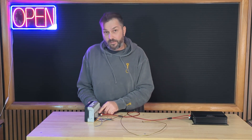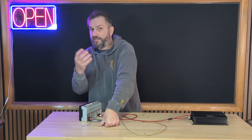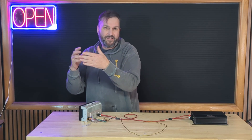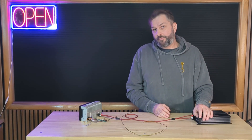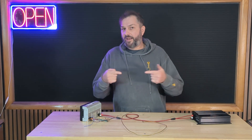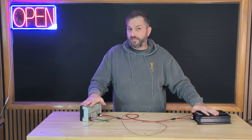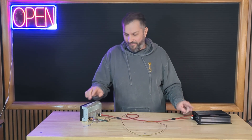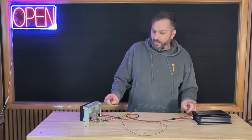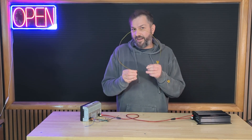The reason for that is because you have a different ground plane at each end. The head unit is connected to the chassis somewhere up front - maybe just the underneath the dashboard framework, which has some galvanization on it that's not quite as conductive as steel, and maybe there's a bit of rust or an air gap. And in the back, you've got your amplifier hooked up to a terminal somewhere on the body. There's always going to be some tiny difference between those two grounds. They're not going to have absolute zero ohms at every frequency because we're talking impedance here. There's going to be some difference between that ground plane, and that's going to make this whole arrangement into a loop antenna.